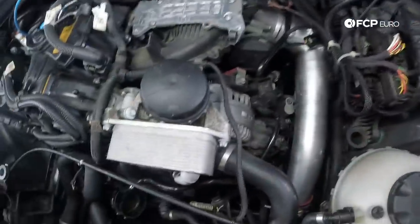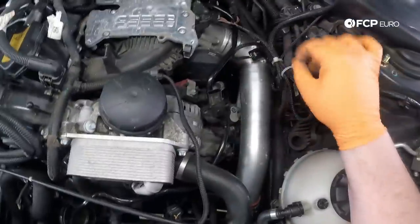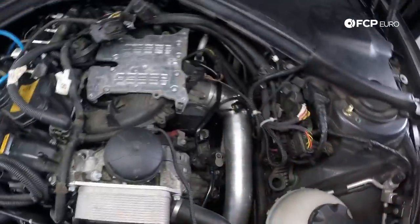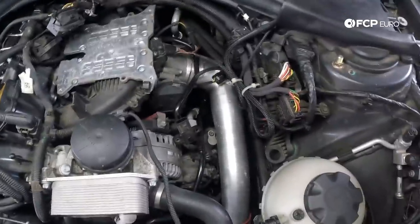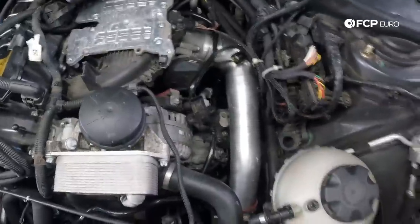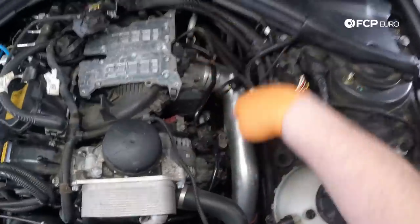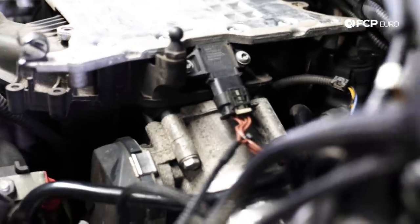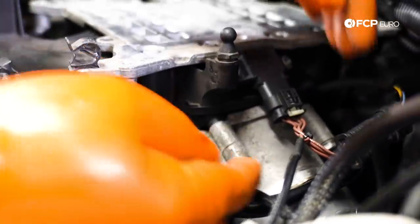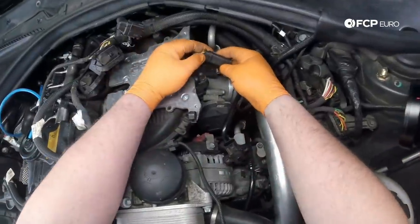So I think one thing to know in this car is obviously some aftermarket stuff, the charge pipe, but this also has one of these inline signal modifying devices, which artificially decreases the boost being read via the MAP sensor. So basically the car overboosts and makes more power. Pretty common. Normally you'd have a wiring lead that just plugs directly into this MAP sensor here, but as you can see, it sort of just bypasses and does all this crazy stuff. We do have to remove our charge pipe here. So I'm gonna start by disconnecting some of these connectors.